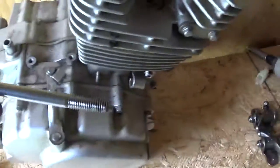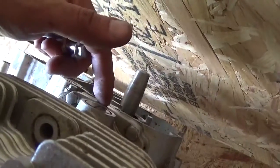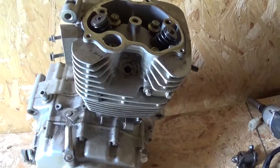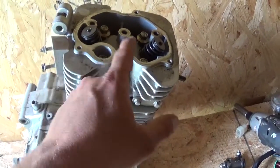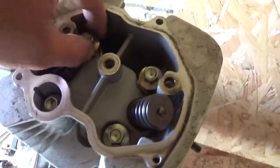And took this bolt here out of the back side, which goes down through this. So you got to line this up. This right here holds the lower rocker arms. This engine uses 1 cam lobe to run 2 rockers. So there's 2 sets of rocker arms, a lower set and an upper set. Further I get into this, I'll show you. And then we got 4 head bolts.